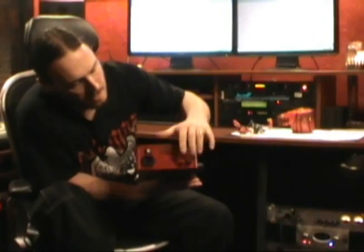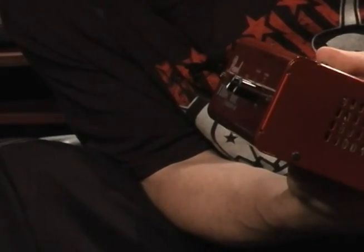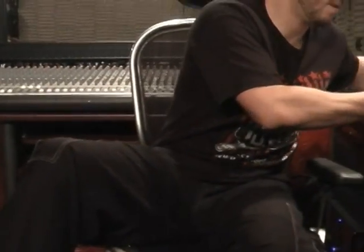As you can see, there's just a power plug, speaker plug, and an audio input. The front is very simplistic as well — you simply have the power/volume knob and the low-pass filter. Turn it up, you get more shake; turn it down, you get less. The more you turn up the filter knob, the more toms you're going to feel. Turn it all the way down and you'll only feel the kick.